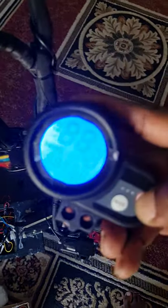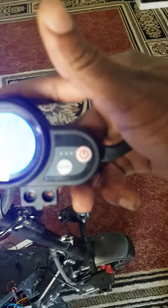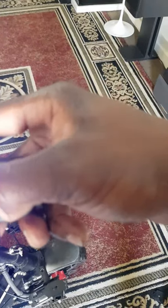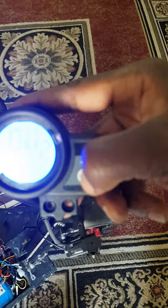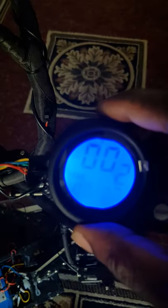Since we're not changing the cable, we don't need a cable. So you take this new throttle side and clip it the same way to the existing cable connector — the pin's got to go in. Clip it in. Now we're trying to diagnose which of the three suspects is the problem. Put the display on — it's showing blue background on the new unit. Let me see if it's showing the same error — yes, the brake light issue is still there. So we know the suspect is not the throttle body, which I'm happy about because I wanted to keep the new one as a spare.